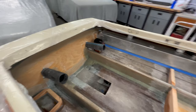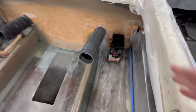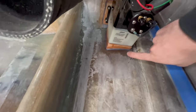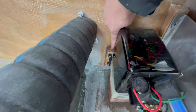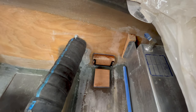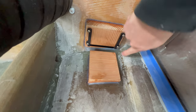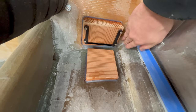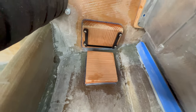Now let's jump over and take a peek at the solution for the plate diverter pump mount. So you can see, pretty much centered it in between the tanks and the exhaust hose, and I built my block down here on the bottom that the fluid reservoir is resting on, and then I also have the block up here that is at the angle, so the bracket bolts to it, and this is loose right now, but that slides into that bracket. So now you can see pretty clear what I did. And I left this gap back here intentionally, so that if I get any water, again, the back of the boat hangs low in the water, so the water is gonna run all the way rearward. It has a channel to run back behind and get to the drain. I didn't wanna build any dams or block any water.